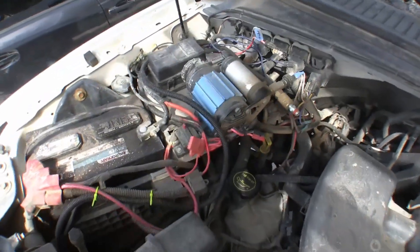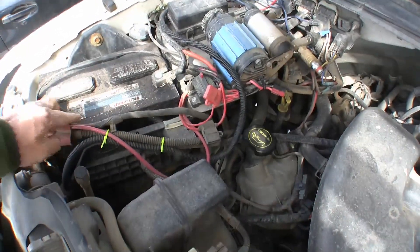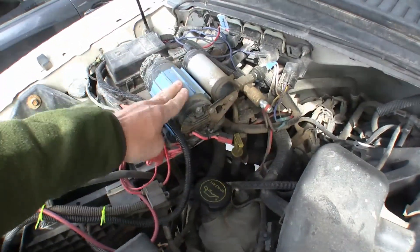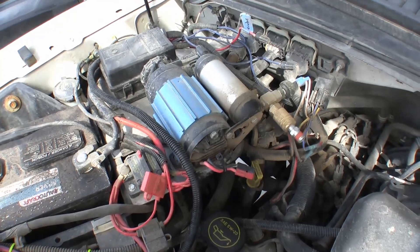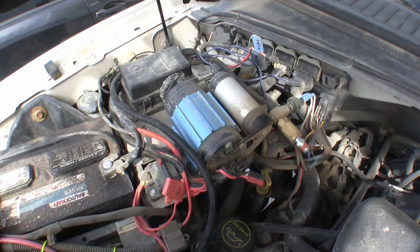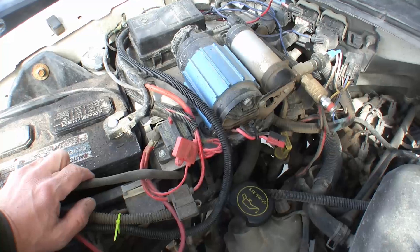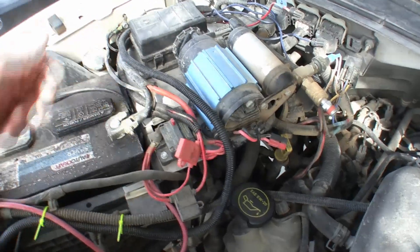Looking under the hood here — I've got a gas engine, 5.4, pretty weak. Just the single battery. I essentially tapped off with some more 6-gauge wire, went into a 100 amp circuit breaker. I built this custom aluminum plate, so I've got my ARB compressor there — I can air up either my airbags as needed manually or my tires if I've aired down. I added a little 6-relay block so I can switch exterior LEDs on and things like that. This 6-gauge wire — negative and positive — they're just running along the frame down to the top front corner of the bed. It's wrapped in spiral loom and pretty well protected.